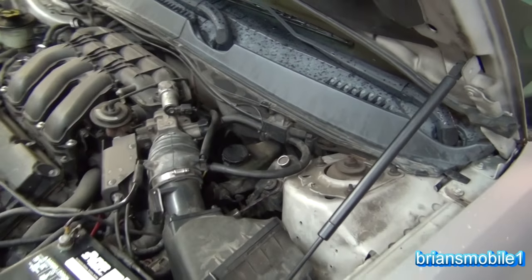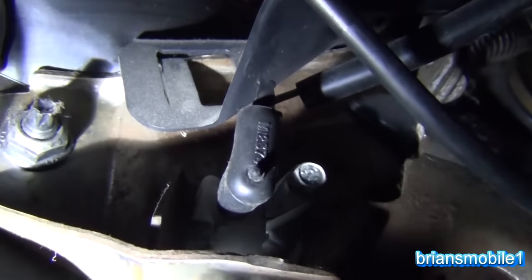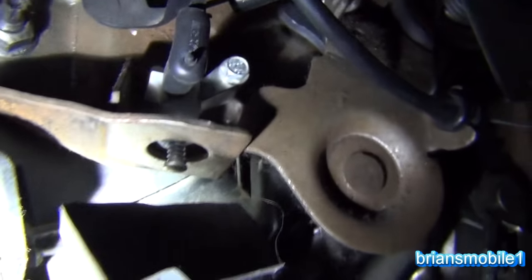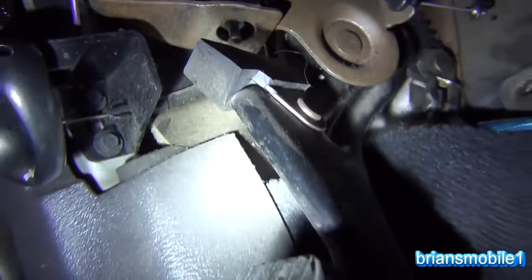On this car, as we go down, you can see that the emergency brake is operated by your foot. And when we look here, we can see there's a little switch — you see that little spring-loaded switch right there with a wire to it? Oftentimes these will fail on a Ford Taurus. A little rubber kickstop goes up and hits that metal plate, and it depresses the plunger and tells the vehicle that the emergency brake has been released.